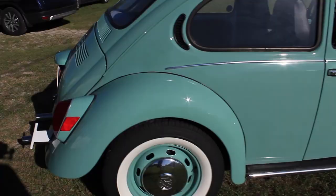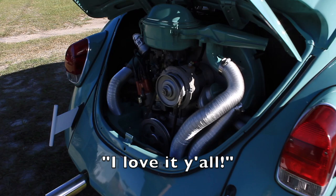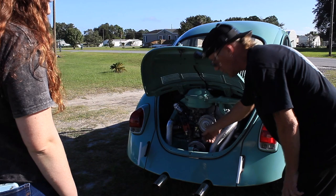Yeah, and Dalton threw in a clear cover to go with it. Yeah, see the motor. And if you ever want to add some oil, just get an 8mm or a flat tip and take this off and carefully move it out of the way. These will crush easily. And when you check your oil, don't ever go by the first pull, and check it often. You want to check it right before you go when it's cold. When you pull it out, don't use the first reading, and confirm it with two readings that are the same.